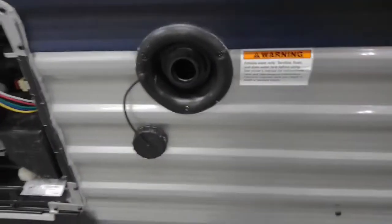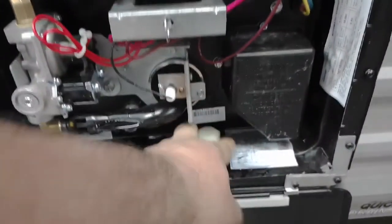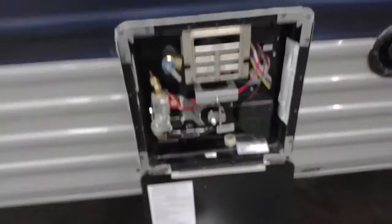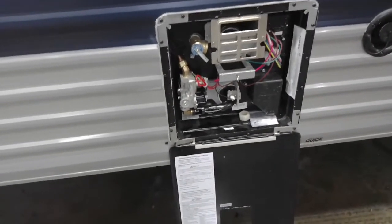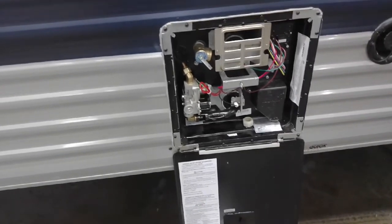Your fresh water tank is here. If you're going to boondock camp somewhere, you'll fill this tank and run off your on-demand pump inside. The drain for that tank is right down there — it's a quick drain, so that white gate valve opens up and it'll drain the tank fairly quickly. This here's your hot water heater. Pressure relief valve — this will relieve the pressure from the system before you pull your drain cap. The cap threads on right down here with a one and one-sixteenth socket. Don't over-tighten it — remember, that's just plastic. Gas and electric are available, and the switches are all on the inside to run that. If you leave water sitting in the tank too long, it'll get stagnant and smell, so I always recommend draining it when you're done camping.